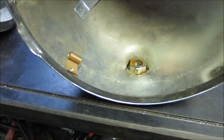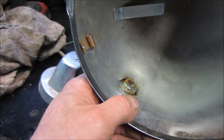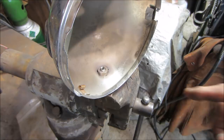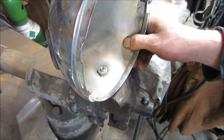I'm thinking we try to get some kind of fender washer, weld that right on to it, get the nut where we want it, and put a couple of tacks on the washer and nut on the inside. I took the bucket over to the sandblast cabinet and sandblasted all the way around — did the same with the one on top. Now I'll guesstimate what's straight out of the bucket and tack it from there.